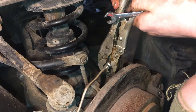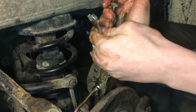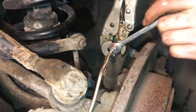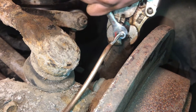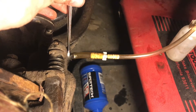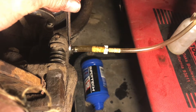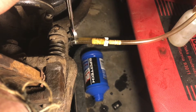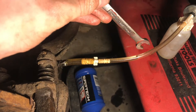We tighten it up a little bit, then take the wrench and really make sure this is going on tight — nice and tight. Now we go ahead and loosen up the bleeder screw and pump the brakes. You can see all that air coming out; we're really getting all that air out of the system. Once all that air gets out, you'll see the brake fluid starting to run up into the bottle.